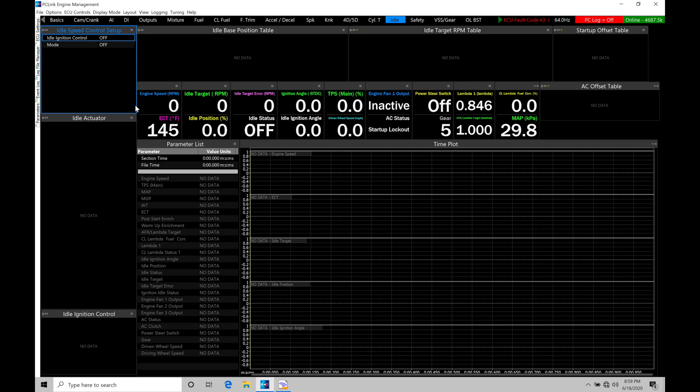We regulate the amount of airflow coming into the engine with an idle control solenoid, and our spark timing can be varied to achieve a higher idle RPM. Allowing more airflow and more spark timing achieves more idle torque. With an idle control solenoid, reducing the airflow reduces the torque the engine can produce and our idle speed will drop. We have the same kind of idea when working with our spark timing.